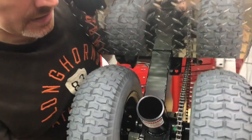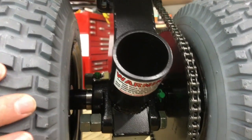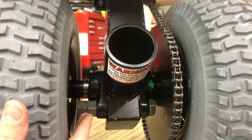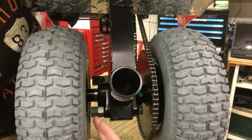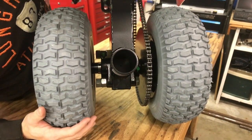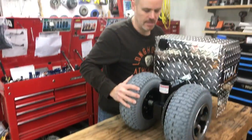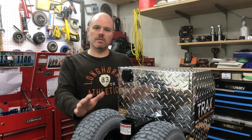These main wheel bearings have a grease nipple on each side. They come already pre-greased and packed, and they're very robust heavy-duty bearings, but maybe once a year you want to give each side a little shot of grease as a routine annual service item. That concludes all the service and maintenance items you need to know about the TX 6000.